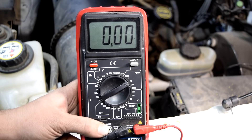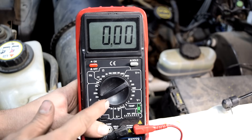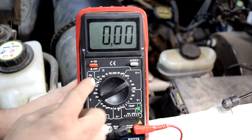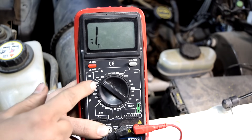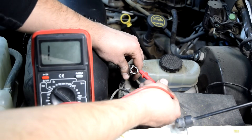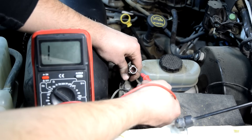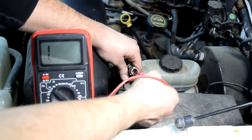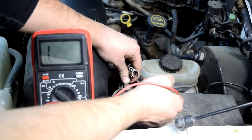Next, we're going to find our constant ground wire by getting our multimeter and putting the settings to ohms, measuring resistance from each pin to ground. We'll use the continuity setting which will give us a reading and an alarm whenever we have ground. While checking for ground, make sure you exclude the pin that was our voltage supply wire, because you don't want to check the resistance of a hot wire. Starting from the right bottom pin — first try, we got it. So our right bottom pin is going to be our constant ground wire.